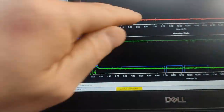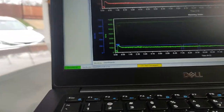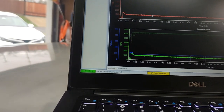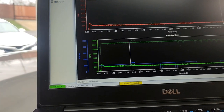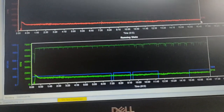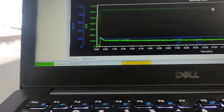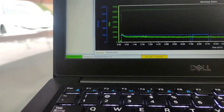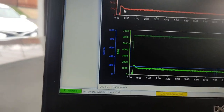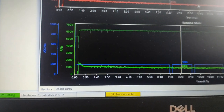There are dropouts where it's going to unplug the throttle position from the pigtail — just unplugged it, made my adjustment, plugged it back in. As you can see, RPM was about 900 for 16 minutes, no changes. Then 816, down to 800 at the end as it warmed up. Battery voltage — that's what the fans kicking in — 13. So as the car got warmed up, the RPM dropped a little bit, hovering around 850.